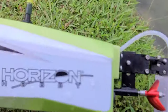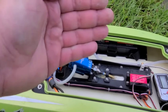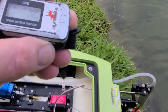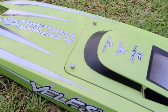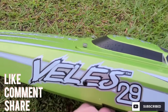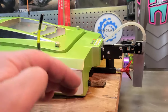My personal best in this pond with this boat before was 69, my all-time PB is 81. With the higher strut position it actually let the boat run drier — less prop in the water, less drag — and it actually handled pretty good with that higher strut position. It'll probably cool your electronics too — not so much drag, not so much prop in the water, so you might have cooler electronics. Hopefully this helps you guys out with your catamaran — I'll try to do more catamaran tuning videos like this. Big B with Ironclad RC — don't forget to like the video.